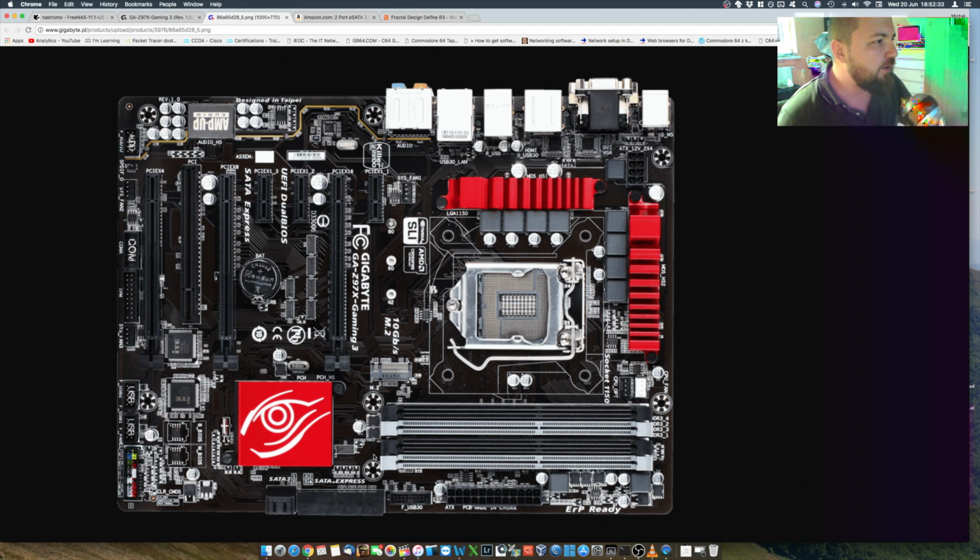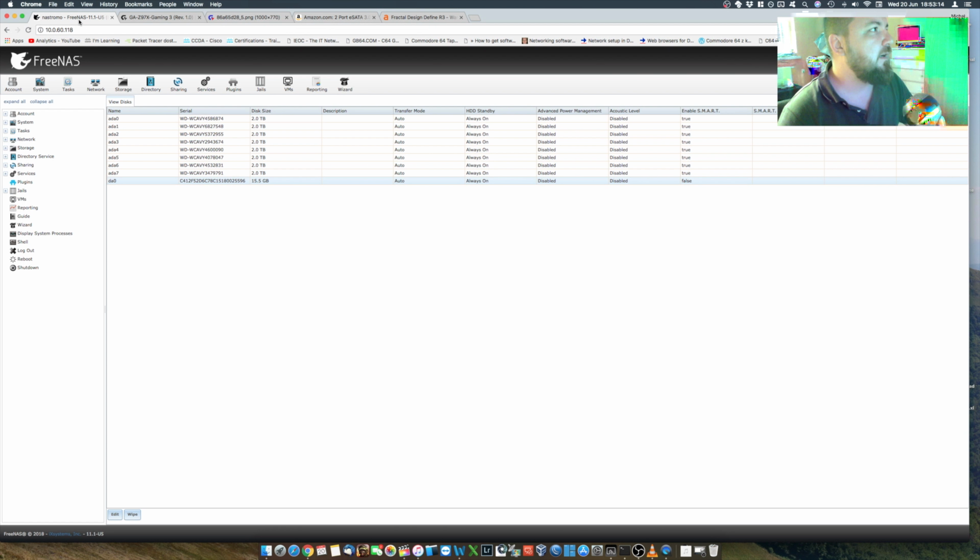And if you are going to buy yourself a motherboard with like 10 or 20 SATA ports, that's cool. Glad you had money, because these are actually pricey. So buy just a simple USB stick, connect it to this header, install it inside the case, and you've got one SATA port free, and maybe you can connect a 4 terabyte drive. What FreeNAS does is, when you boot the system, it reads the whole contents of this USB stick and keeps it in RAM, so not a big deal. Plus, if you are still worried about what is happening, I will try to find this. Just give me a second.